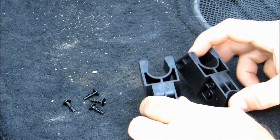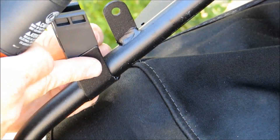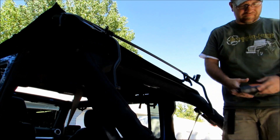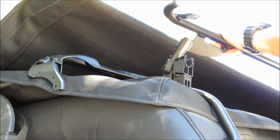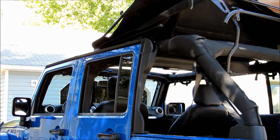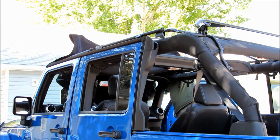Once that's done on both sides, grab the bow stops and their small screws. Orient them so they angle forward. With those installed, grab the number four bow assembly — it also has spring-loaded catches. Orient it so the curve faces rearward, then snap it into place on both sides. Lift up the number three bow assembly and slide it under the rear of the canvas top to make the next steps easier. Fold the top forward and then fold the whole top down over the hood. If you're worried about scratching, throw a blanket over the hood first.